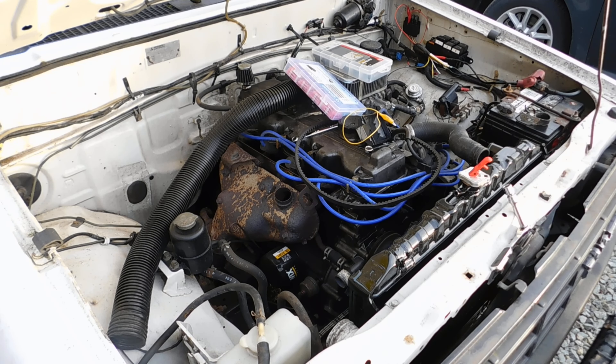Let's see how much coolant's left. All right — no pressure escaping, it's got coolant in there. We still have coolant, so that's cool. Normally after I drive this truck on the old radiator, after the five to ten minute drive I just did, the top of the radiator would be empty. The overflow is not overflowing — it's a bit higher than full, but I never emptied it.